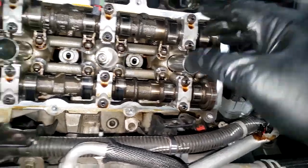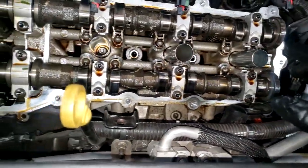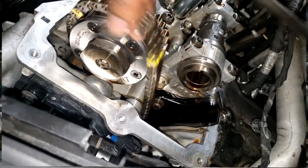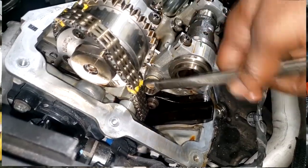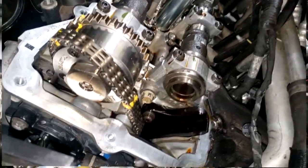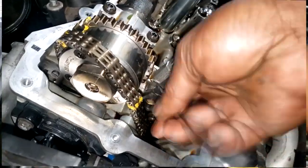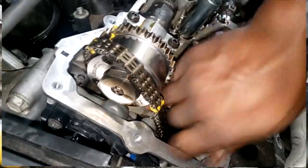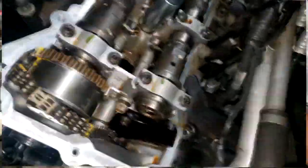This one doesn't have any play. I'll clean all of this off — you can see a little powder shaving here. This car once had a rocker arm problem and somebody likely fixed it. So yes — tone wheel, oil galley plugs, the actual cam phaser — all of that could be the reason you're losing oil pressure and causing camshaft codes to set. She just had an oil change, so that could also be the problem. The oil galley plug was loose, and I'm going to be honest — I'll order myself the proper tool.